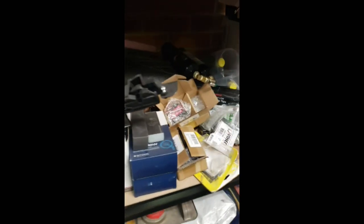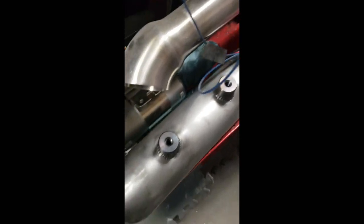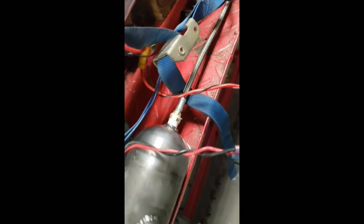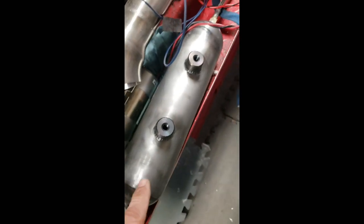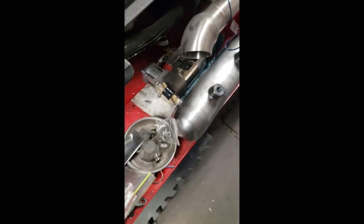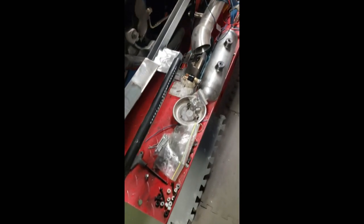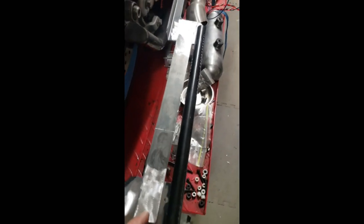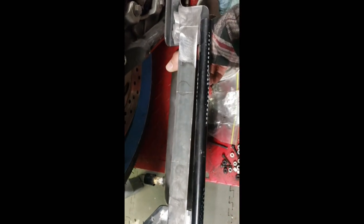Among other things I'm working on — here's my fast-up tank. Before, I made my tanks out of two nine-ounce paintball bottles, then I got a couple of 20-ounce paintball bottles, and then I found this one — I think it's a one gallon. I've got a pressure switch on here — a 120 to 150 pressure switch — and then I've got my 24-inch stainless lead line on there. This is designed for a Harley so it mounts to a bottom rail, which we don't have. So what I'm going to do is use the D-chopper brackets, and I've cut myself a piece of one and a half by one-eighth flat bar stock. I'm going to weld it here, then drill it and mount the tank underneath the bar here.